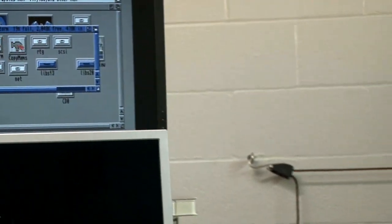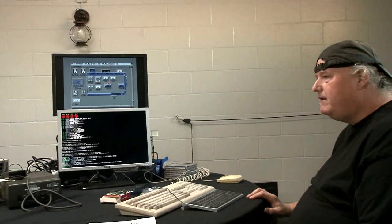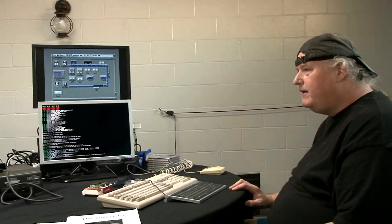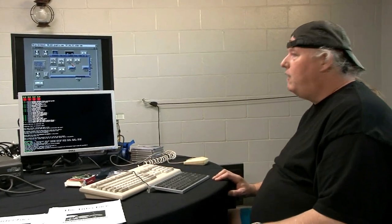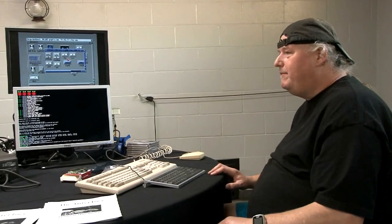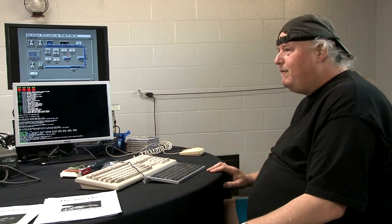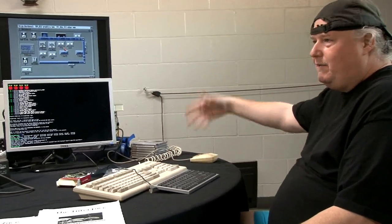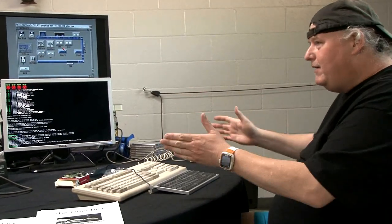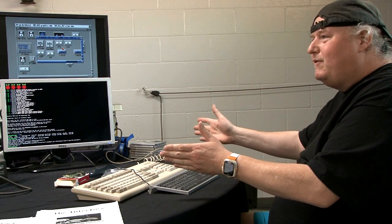You were saying that since in the 2000 you were using the CPU slot, you had to pull the 68000 off of another board. Does that 68000 get plugged into the PiStorm? No. So the PiStorm replaces it. Okay. So you just put it away. It was mainly because the 68000 was trying to engage. It was trying to turn on when you turn on the machine. They were both trying to engage the same memory. Was it address 0 they both start off with?